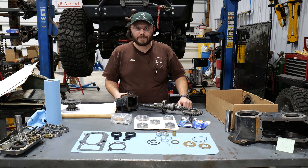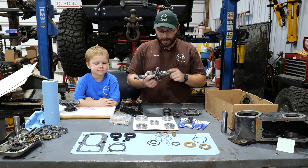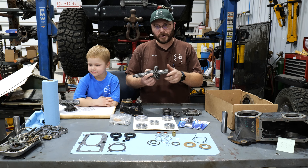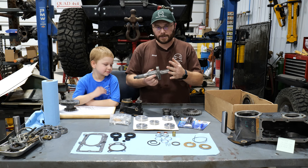When this low range gear on your main output shaft is installed, the bearing goes right here with the snap ring and the thrust washer underneath of it — and that is a pain to get out. In most cases your thrust washer will be in good shape itself, but we include one in the kit because there's not a lot of room in there and I did happen to nick mine a little bit when taking this transfer case apart. We included it so you don't need to worry about it.